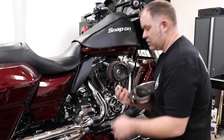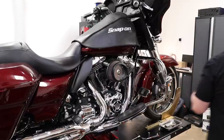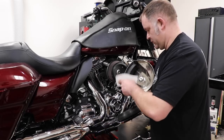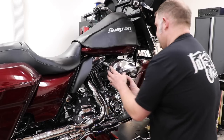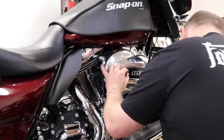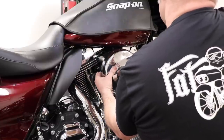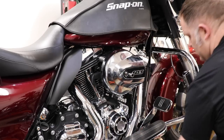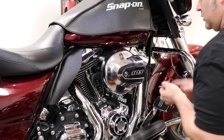Bolt. There's a washer that goes over top of that. It goes through. Then it gets a spacer. Let's clean this gentleman's old oil out of there. And then we're going to put some blue Loctite on the bolt. 3/8 Allen. And it threads right in. That's it.